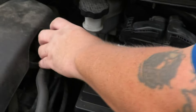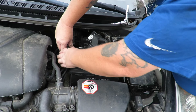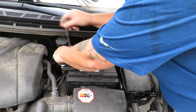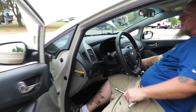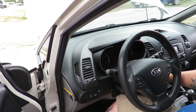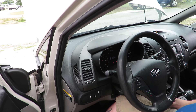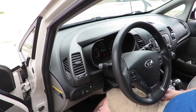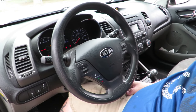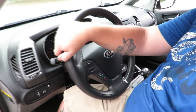Put the fuse back in its spot, then reconnect the battery. There's no certain way the fuse has to face — it goes both ways. Give it a second to prime the fuel pump. It may bog a little bit until it's fully primed. You only need to start it once, and then take it for a drive after you're completely fastened up.